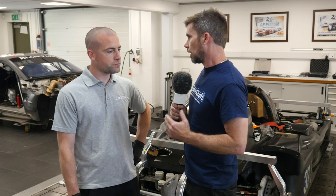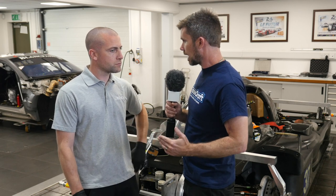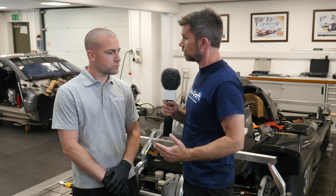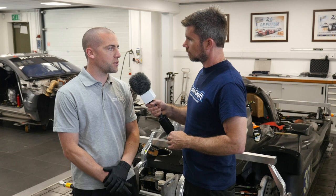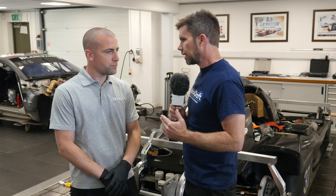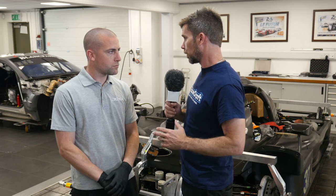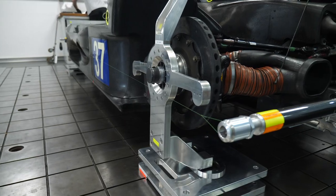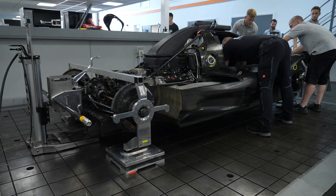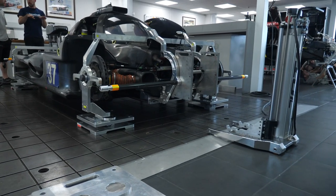With the alignment setup, the other main aspects we look at are camber and toe. Starting with camber — what equipment are you using to measure it? We use a digital camber gauge which is zeroed and checked for accuracy at all times, and that is placed against our setup wheel to take the reading. Compared to setting up alignment on a conventional road car, it's quite different because as you can see, the car has no wheels on it. The setup plates are machined billet, which ensures there's no deflection, it's repeatable, eliminates the tyre and anything movable — just to eliminate any discrepancies and be consistent.